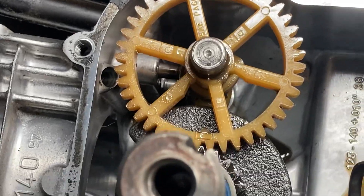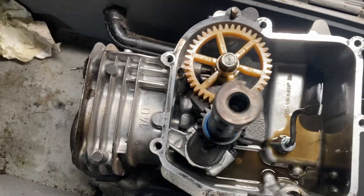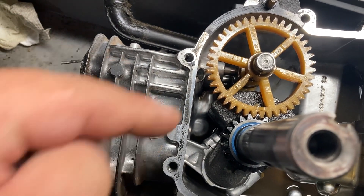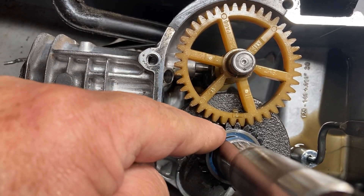But if you look in any of the manuals — well, there are no manuals for the E-Series. Actually there's one manual but it's kind of sketchy. It's got torque settings and all that, but nothing about the alignment marks. So I'm looking around the camshaft like, are there any other marks? On most Briggs, that little tab and that little mark signify the timing mark. And on this gear there's only one triangle molded in.